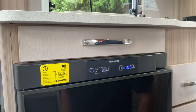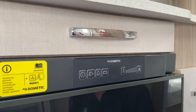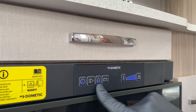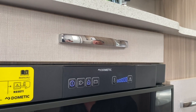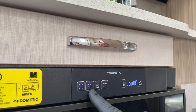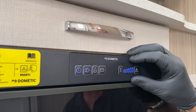I'm going to turn the fridge off — there's the refrigerator off. Now I'll turn it on again by pressing the button in, and it will always go back to the last source it was working from. In this case that's gas. If I don't want to work off gas, I press the mains symbol once and then press it again — that's now changed it to the mains supply. So you press it twice to change the source.